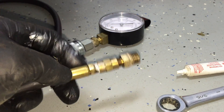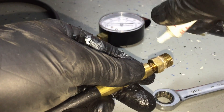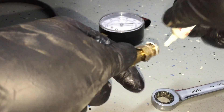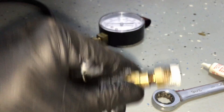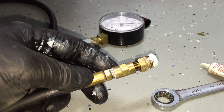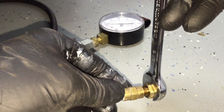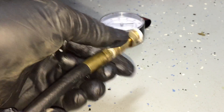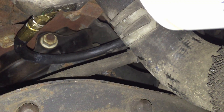These two pieces are nice and tight together. Put a nice bead of thread sealant on the other connection as well, making sure it's evenly around, then go ahead and screw this into the port on the vehicle. A quick note before you start screwing it in - make sure you have your hex size figured out, I think this one's 9/16ths. Get it up in there, turn the hose and everything all at once, get it tightened up by hand, then finish it with the wrench. Once that fitting is nice and tight, go ahead and start routing the hose up into the engine compartment.